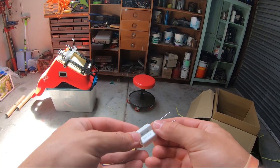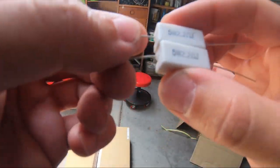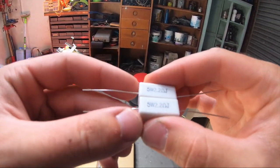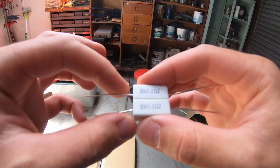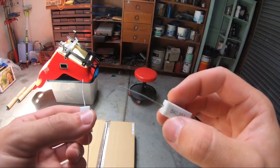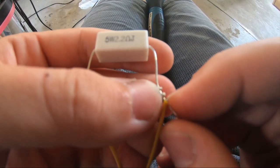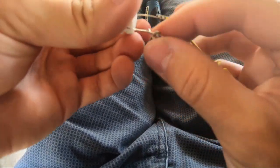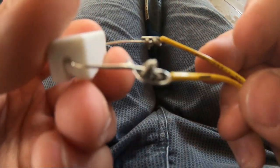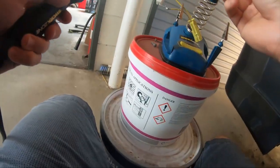What you want to do is go out and get yourself some resistors. I've got these ceramic resistors — five watt, 2.2 ohms. These will be different for different cars. You can actually get delete kits from Recaro or Sparco depending on the seat manufacturer, but they don't necessarily work for all cars. In my case I need a 5 watt 2.2 ohm resistor, so that's what we've got — two of them, one for the passenger and one for the driver. Get yourself your connector, wrap it around a few times, then grab your resistor wire, bend it back so you have a nice little bundle of wires, get them nice and hot and put a dab of solder on.